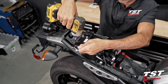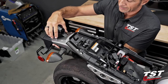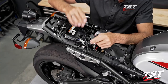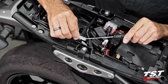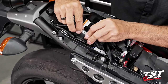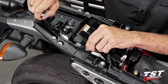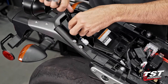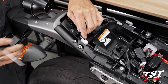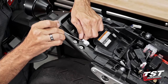We have just gained ourselves access to all the wiring that will need to be disconnected. We are removing the entire fender off the bike, so all the lighting has to come out with it. We have this set of connectors here — that's the license plate light, a very simple connector. Pry up on this locking feature and pull them apart to disconnect them. Same concept here — the male is on this side and female on this side — pull up and disconnect. Now we can un-route these wires from the cable management system here. We have the taillight connector — it gets secured to the sub-tray here. Just press on this locking tab until it unlocks and withdraw it.